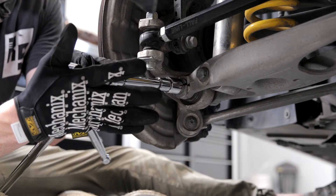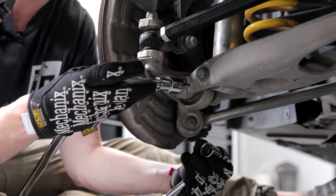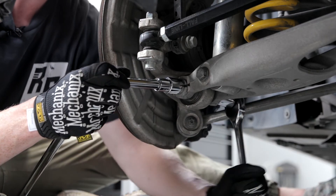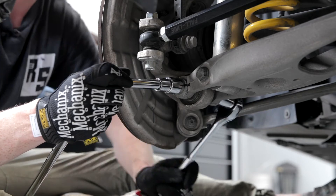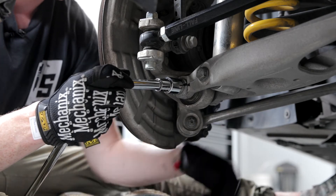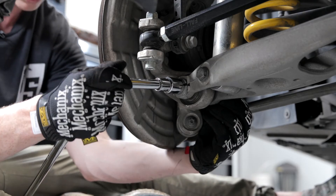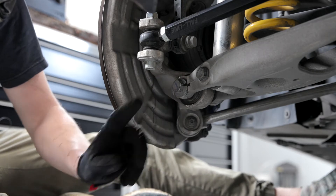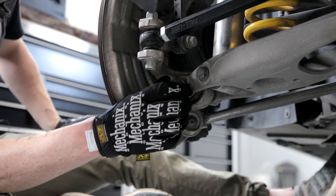Now that we have it marked up, we're going to get our 21mm on this side. You don't want to spin the side that has the fixed washer because that will spin the threads within and there could be tension. You want to loosen from the other side — loosen the nut off the bolt to remove the tension before you ever spin the bolt itself. I've got both my 21s on here. Once it's loose, this bolt comes off pretty easily. Initially I'll leave the bolt just slightly loose — this will allow me to line up the shim I need by pulling it out and lining up a shim behind it.